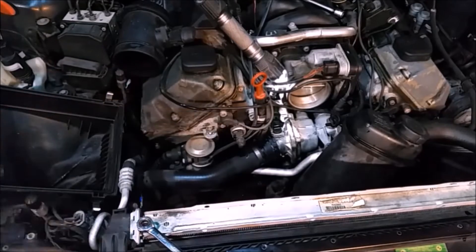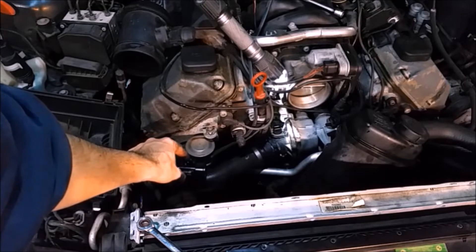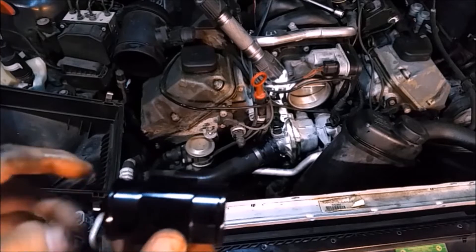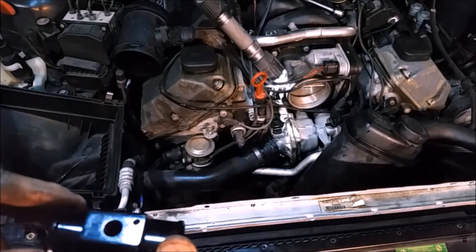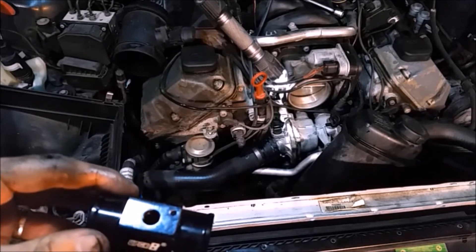This is our insert that's going to go right here in this coolant pipe, and that's going to house our thermo switch. All I'm going to do is trace off this width right here, cut the hose, slide this on, clamp it — then we'll be able to put our thermo switch in there with our ground wire, and we'll be done.